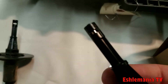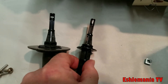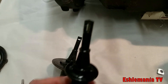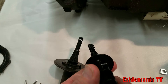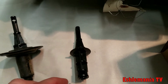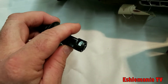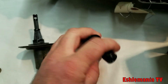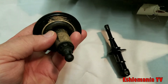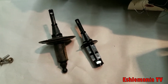You'll notice this new replacement joystick has a magnet in it. The one we took off was on the right rear of the mower, and when it comes new from the factory, that one actually does not have a magnet in it because it's just a dummy joystick — it's really only used for holding the body. But the only replacement you can buy is the one that comes with the magnet. All we have to do now is take the nut that came with the new joystick, put it in the slot at the top, and then transfer the ball and the rubber boot from the old joystick onto the new one. Then we'll throw this new joystick in and be good to go.